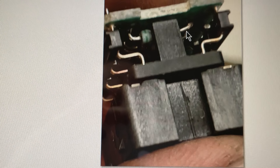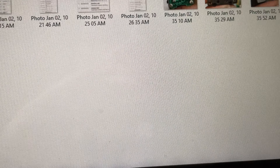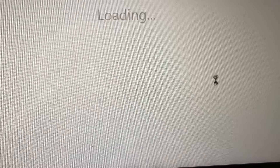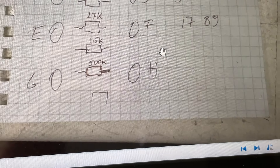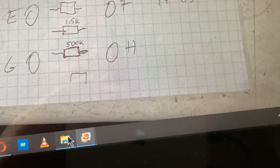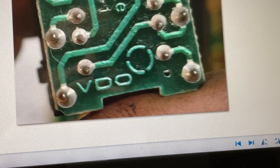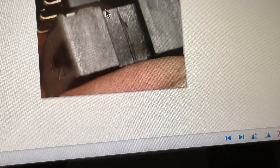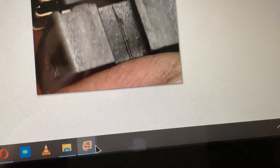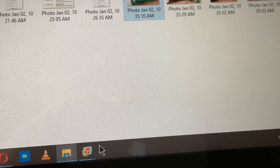This control unit was replaced by the 0532, which was then replaced by the 0732 — that's the second generation I have. Then came the 4032, the 7732, and the 2132. The coding parts stayed the same, so you have a total of five different control unit part numbers, and any one of them will work with the coding plug.